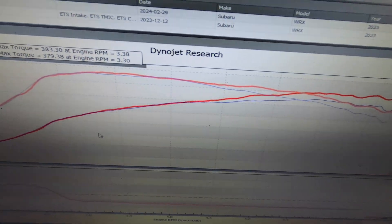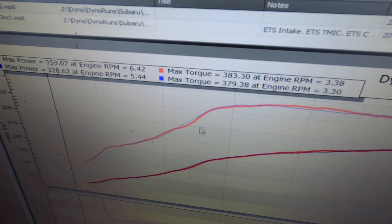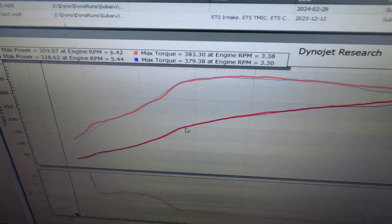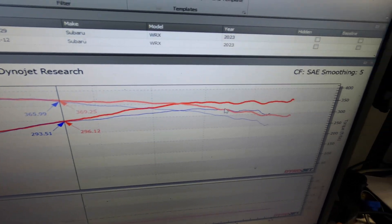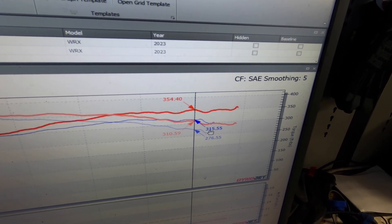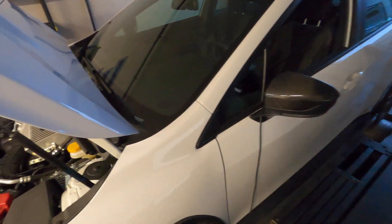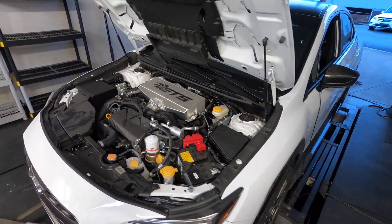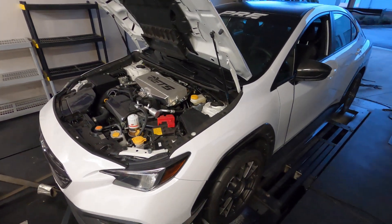Here was the ETS run — you can see I'm running the same boost down low. This is a larger turbo and the spool is identical. Power delivery at lower RPM is exactly the same, so you don't lose anything switching to this turbo — you just gain power out the top. Past about 4200 RPM we're just breathing better and making more power up top. Past 6000 RPM that's about 40 more horsepower. This is a pump gas 92 octane tune, left the top mount, didn't switch to the front mount, and it seemed to do okay — I stopped at 19 pounds.